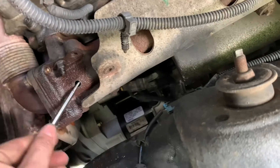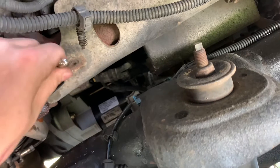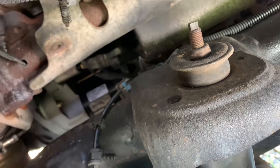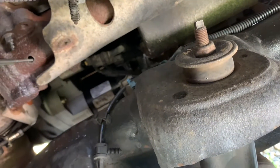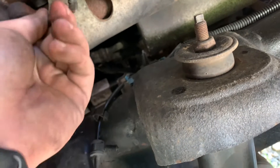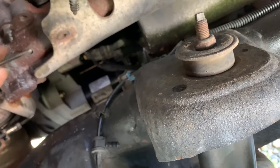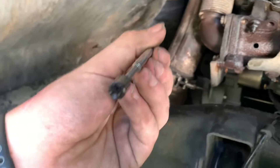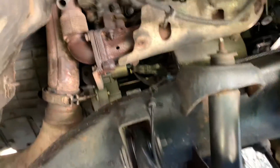This is just a statement — if you don't get every single shaving out, it's not super crucial. If one of these little bitty tiny shavings hurts the exhaust turbine on your turbo, chances are your turbo was about to go out anyway. That said, we got what looks like probably all of it.